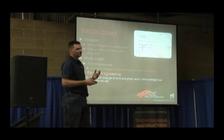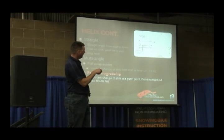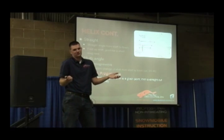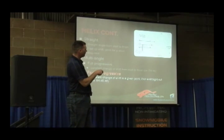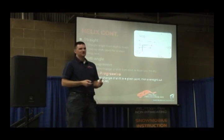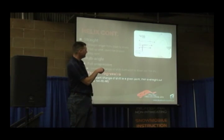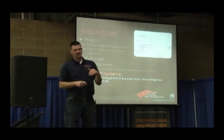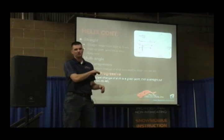Partial progressive, or what we call a mountain helix. What it's going to do is start in one angle and hold that angle for a certain distance — this distance here says 0.460, which is basically a half inch. Then it's going to shift to another angle all the way to the tip. So that's your multi-angle helix. Let's say it's a 73-57. It's going to hold the 73 from here to here, then radius cut or shift very quickly to a 57, and hold a straight angle after that.